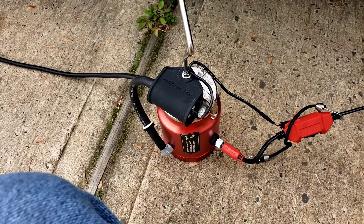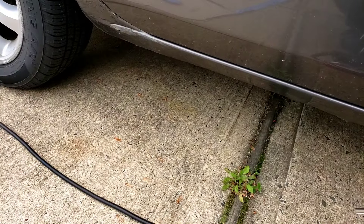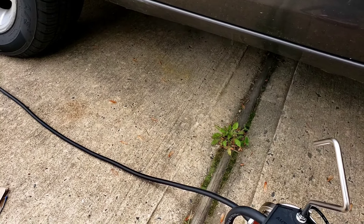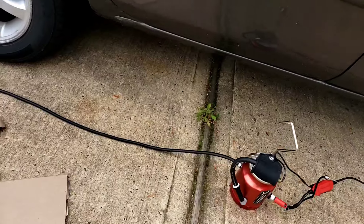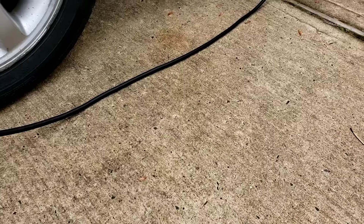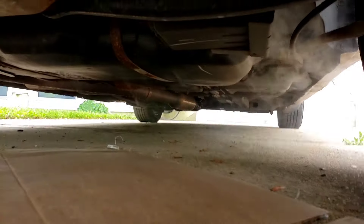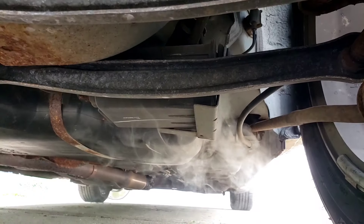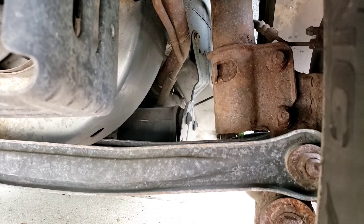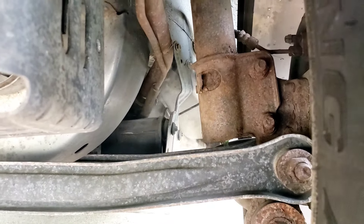Takes a couple minutes — the coil's got to heat up and the pump is pumping. Do you see it? See the smoke? It's coming through there. Let's take a quick peek in there. Okay, that's where the EVAP leak is. See if I could curl in there, otherwise I'd have to get a jack and jack it up. It is smoking. There it is, coming through there. That's a canister I think — that's where the EVAP leak is.